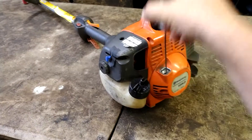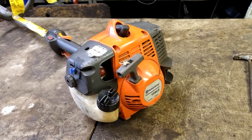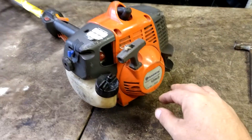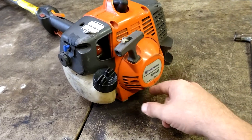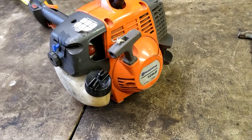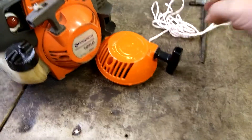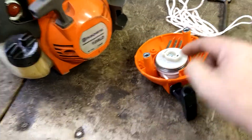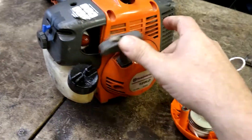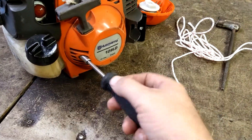Today we're going to fix a recoil that's not working on a Husqvarna 128LD. Parts will be in the description below — this is a very easy job. This one has a bad inner spring, the secondary spring. I tried looking it up on Amazon but couldn't find just the spring, so I found a whole new recoil assembly with a spare bit of rope for super cheap. You can see the spring right here — that's what's broken. When your recoil is spinning but not engaging, it's the secondary spring. It could be the pawls, but I'm pretty sure it's not that since I've already opened it up before.